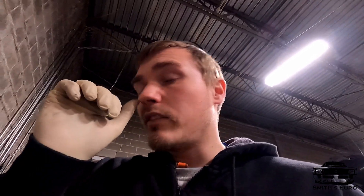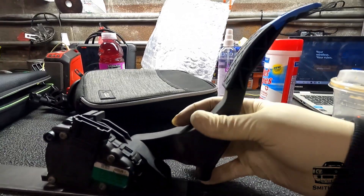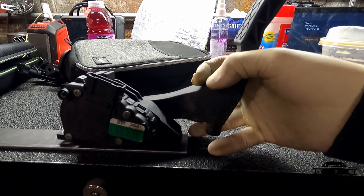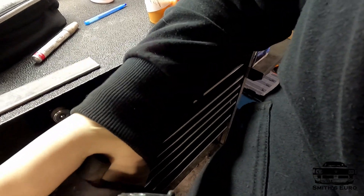I'll find three relatively long bolts that match the OEM ones and I'll just tack weld them on the back of this — that'll be the base plate. We'll bolt the pedal to that base plate. I'll probably do it down here because this is actually a pedal stop right here. I'll have to add something for this, a little bend or something. It does stop — it's not like you can really overextend it. You just don't want to overextend it. As long as you get it right to that end and put a bar there to stop it, you'll be golden.